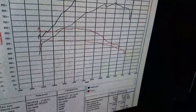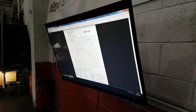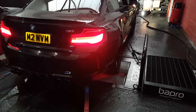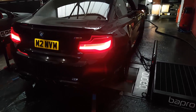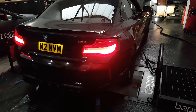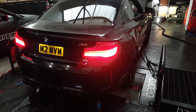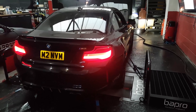The results are in — final results: 427 brake horsepower, 653 Newton metres of torque. It's running really healthy. At the top end we have got a bit of timing pull, but that's down to the heat in the dyno cell, so on the road we'll log it again and make sure the timing is as it should be. You can see what a turbo back exhaust does to an S55 engine, specifically the M2. Well within tolerances at 430-odd brake horsepower — should make it an animal on the road. Compared to stage one it was 414 horsepower and 620 Newton metres, so it's a lot more delta and a lot more acceleration. Thanks for watching guys, don't forget to like, comment and subscribe, and stay tuned for hybrid turbo development.